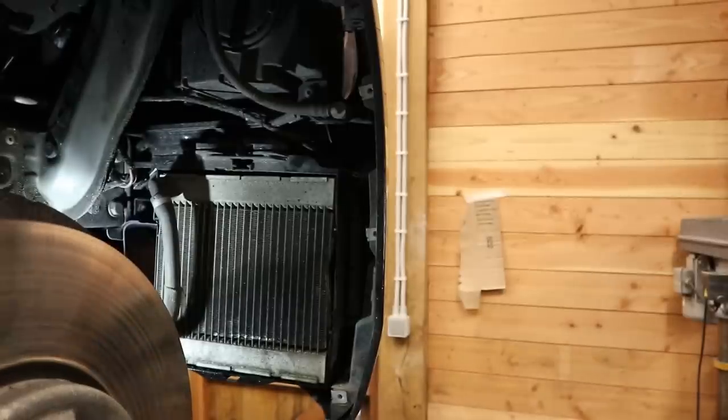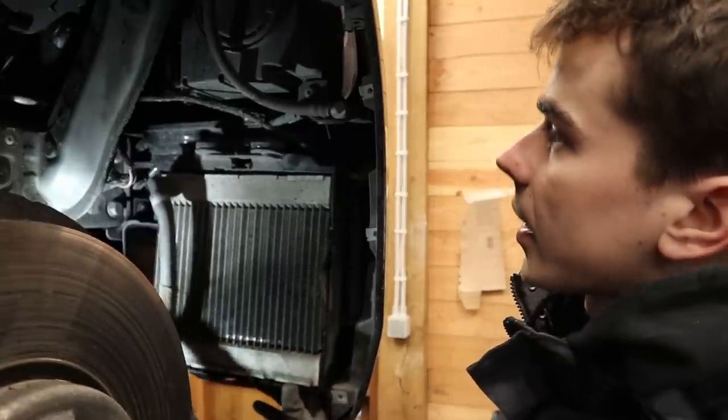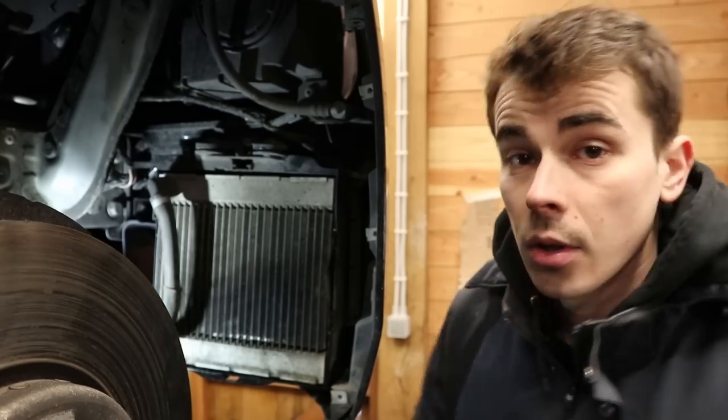The hood install is done. Now we just have to wait for the bumper to come in, but in the meanwhile there is some work to do on my dad's BMW. At the beginning of this video I told you that his BMW yet again has an issue — a few days ago I diagnosed it as a leaky transmission cooler. I've been waiting for a replacement to come in and today it has arrived. So let's pop off that front wheel and take a look. Here we have the transmission cooler — it's just one bolt and two hoses, easy stuff.